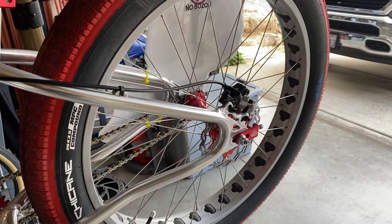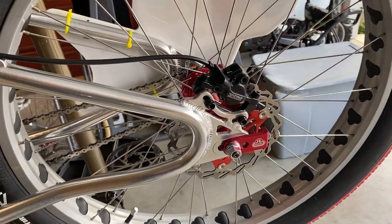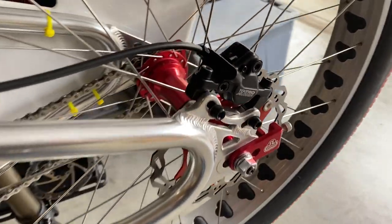Let's take a look at some other things — we'll do an actual rotor inspection and see what we can find. If you've done a visual inspection without tearing anything off, things are still not going great, and you've realigned your caliper body but you're still having issues, it may be time to do a little bit further digging. Start taking things apart, inspecting the rotor, maybe changing your brake pads, and really going through the whole setup to see if you have any other underlying issues.